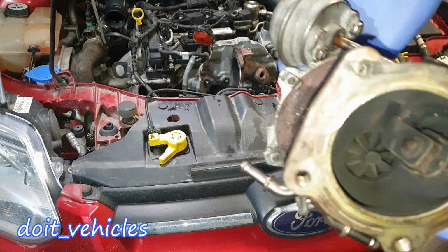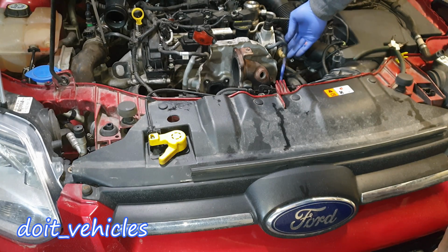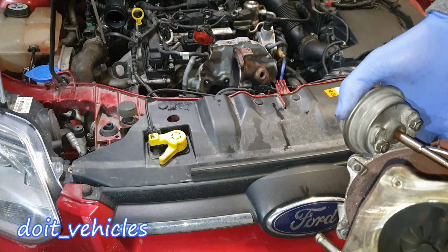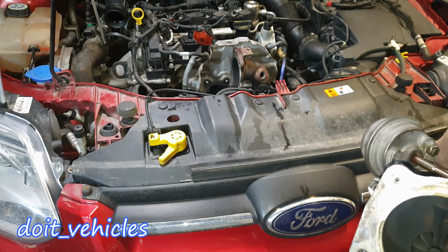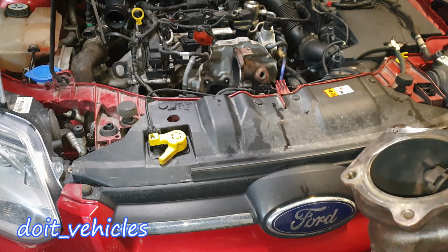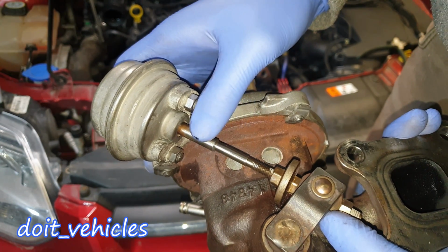And now you might wonder how the code will be triggered if this mechanic is not connected to any electric sensor or anything. Well, you've got here the solenoid, which is basically sending the vacuum through a hose which travels around a little bit the engine, and then it comes here. It will activate this, and if the computer knows that the solenoid is on, you might also get a trouble code for the solenoid or the manifold absolute pressure sensor, as I said. So it depends. For one fault you can get a diversity of codes depending on how the computer is programmed to respond in these situations.